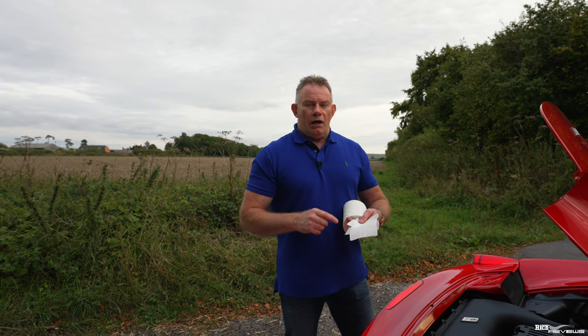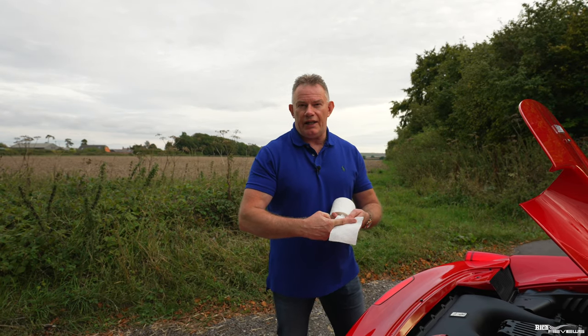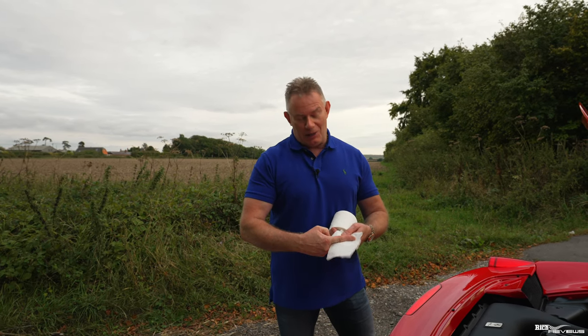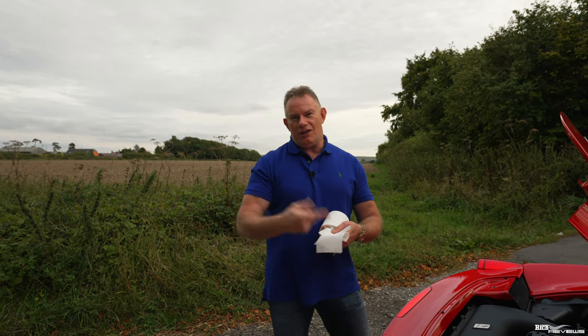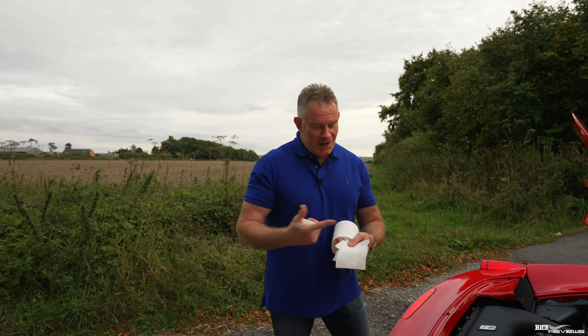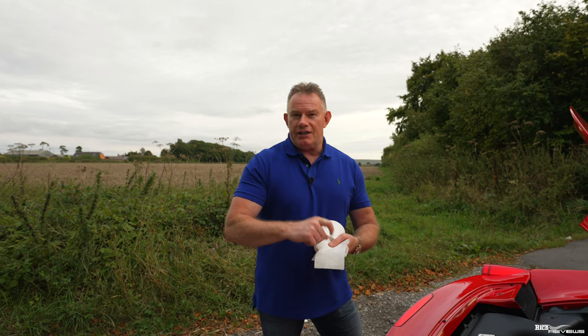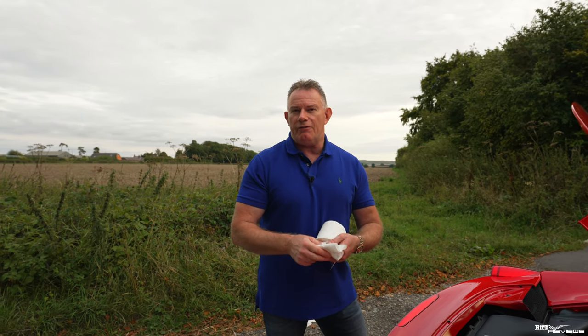And it's very important as well that you hold the dipstick horizontally. I know I'm probably teaching my grandmother how to suck eggs here, because it's obvious you keep it horizontal. If you hold it up, obviously the oil's going to drop down from the dipstick marking. But just to make sure you guys realize, keep it horizontal so the oil stays on the dipstick markers and you can read the dipstick level for the oil.